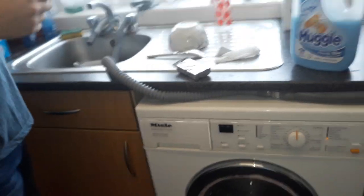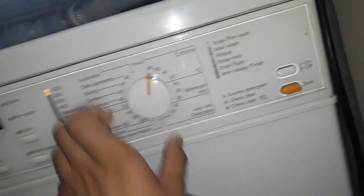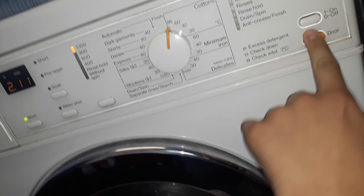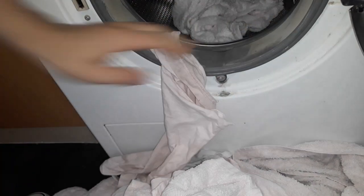You're getting a new Miele. Go ahead and load it if you want. We'll use Cotton 95, no options — I'll do Water Plus. There's a limescale tablet; I've broken it up. What I do with a limescale tablet — watch this — straight in the seal. So it'll start already taking effect, breaking down all the limescale there now.